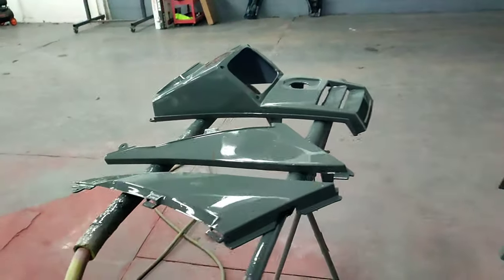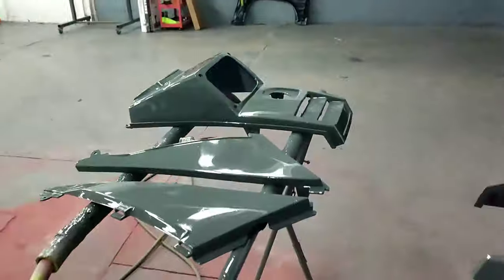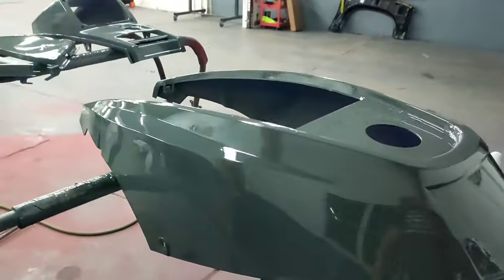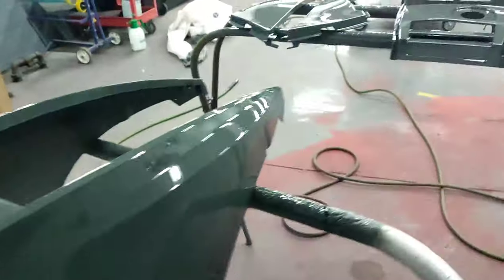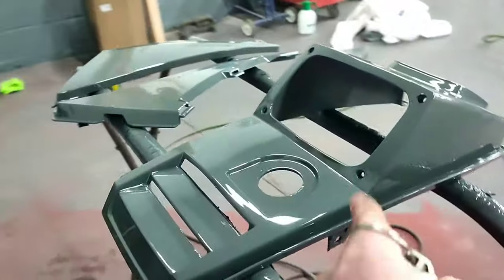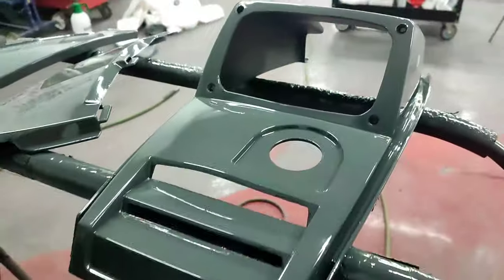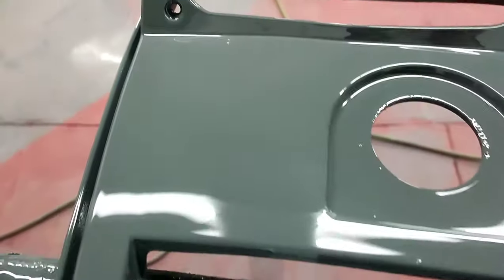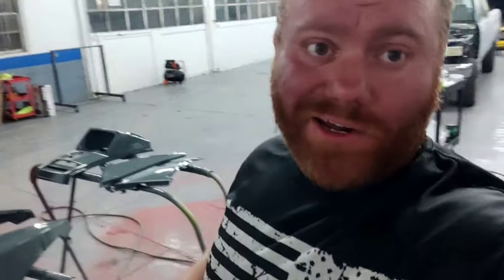Standing a couple feet away — super nice gloss, really really nice glossy finish. The color looks good. I did tint it just a hair with the Speedico Jet Black and darkened it up just a little bit. These things came out pretty darn smooth for some beat-up old plastics. So for those of you that didn't know how to paint ATV plastics before — well, now you know. Hope you guys enjoyed the video. Like and subscribe — new videos every week.